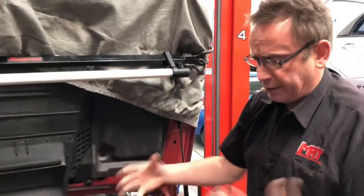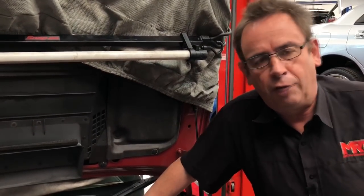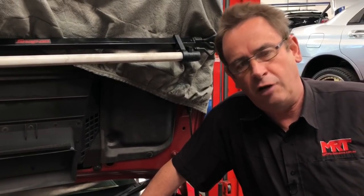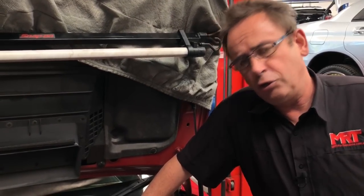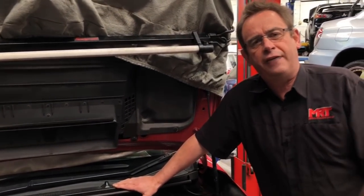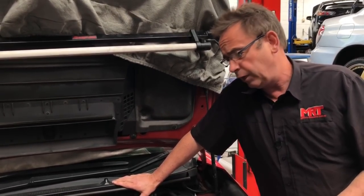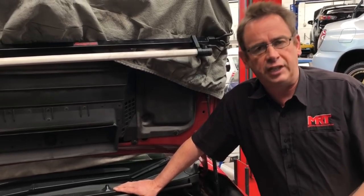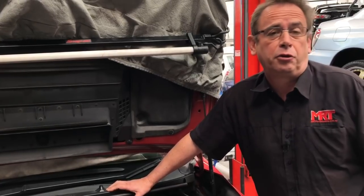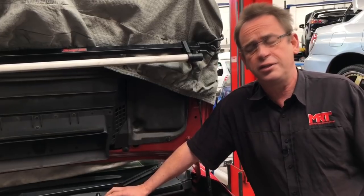When it all goes back together, this package of parts is going to give us a lot more confidence when this engine is run up on the dyno to deliver the right power results. So when you're choosing these parts, my advice is don't just look individually at what's supplied — you need to carefully consider the way they all work together. Bigger is not always better. We get a lot of people come to us and say they're going to put 1500cc injectors in their car, and we ask why. You don't really need them. They say they thought bigger was better. That's just one example of things you need to carefully consider when you're choosing the parts for your engine.